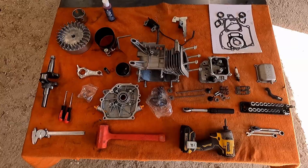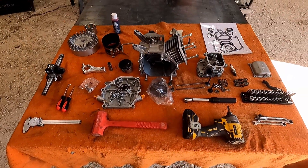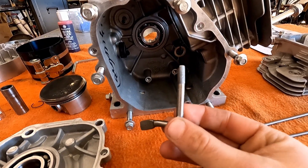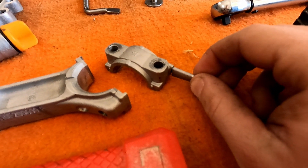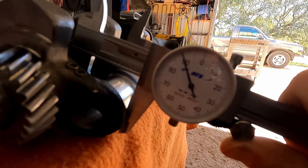What's going on guys, it's Bataha doing some upgrades on the 212 Hemi. We're installing a 265 hot cam, billet rod, 22 pound valve springs, and a cast aluminum flywheel. I started out by reading the instructions — that should surprise some of y'all coming from me. Checked the crank and we are within spec.